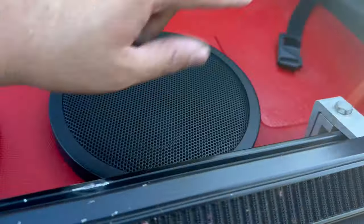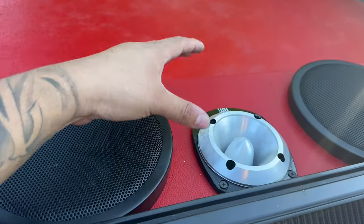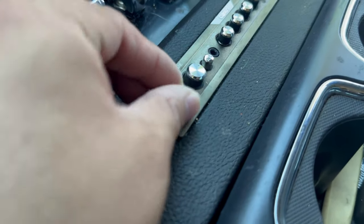Previously I had problems with the amp going into clipping a lot and it would go to protect, then the amp would just shut itself off. Under this panel with the mids and highs are my batteries, and I had corrosion on one of the terminals. I cleaned it with a wire brush, got new washers and a new bolt, and now it's making solid metal-to-metal contact. But with myself turning my sub volume up high and just being a typical bass head, I'll throw the amp into clipping mode and it'll go into protect.